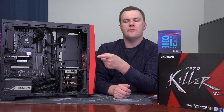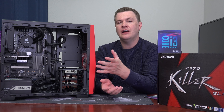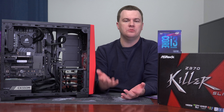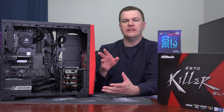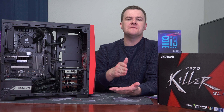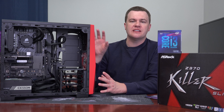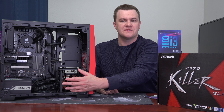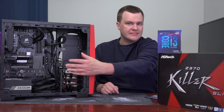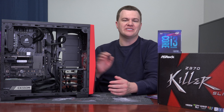The main SSD is one of the biggest things I'd change — I mentioned this in Part 1. This is a 128GB drive and I wouldn't buy a 128GB drive. I had this on the shelf from a previous comparison video. Go with at least 256GB — the price difference between 128 and 256 is only about $15, which makes no sense to skip. Adding more SSDs just to get space is avoidable, and you'd certainly solve a lot of the cable mess back here if you didn't have all those extra SSDs installed.